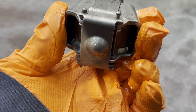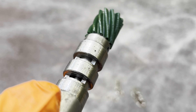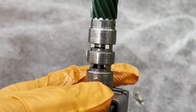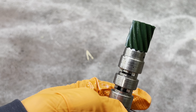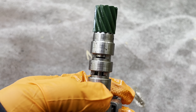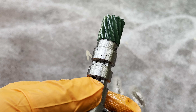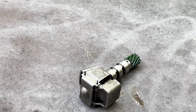Take that circle piece off and you're going to see this — it's going to be in like this, you'll see the back part. Give it a little twist and then pull — it'll come right out. Once you take it out, to test it: these go in like this, and you pay attention to this right here. You can see this one is moving — as long as it's moving, you're good to go. That's functioning like it should. If that's working fine then you've got something else going on. Check vacuum — make sure you've got vacuum, because if you don't have vacuum it's not going to change gears.